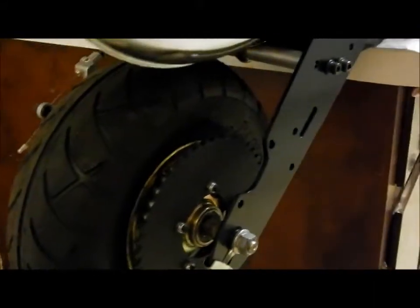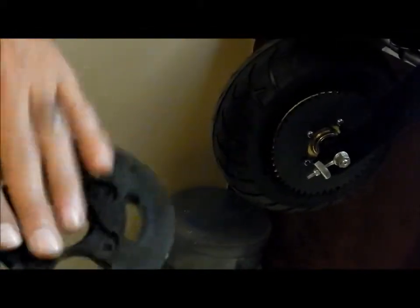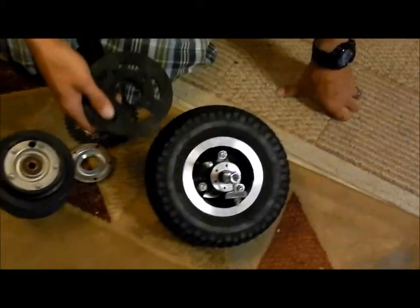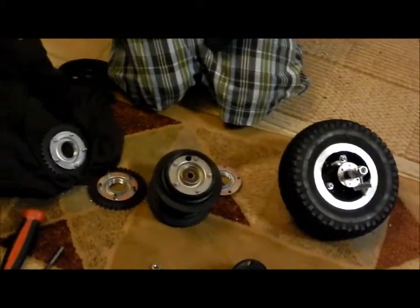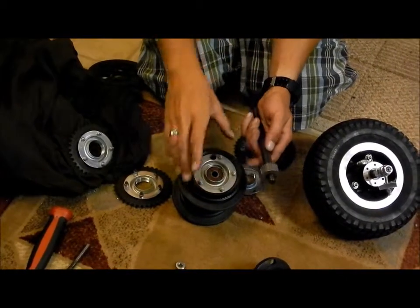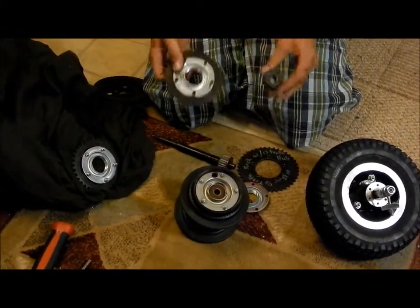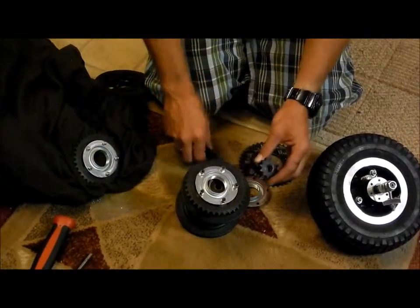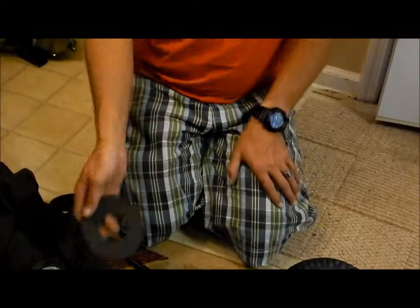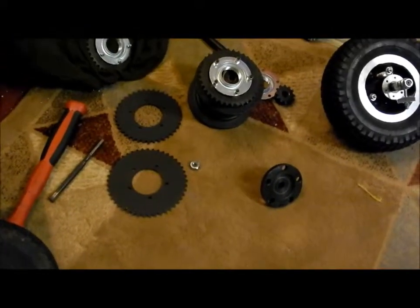The same hardware kit works for both models — including models with bigger tires that have a star-shaped sprocket recess. If you have one with a star-shaped sprocket recess, you may not be able to go with an aluminum wheel unless you decide to go chain drive. The Nuke Gas Scooter's factory gear ratio is 20 teeth to 60 teeth — that's a 1 to 3 ratio. For chain drive you would go 12 to 36, which is the same ratio. But if you want more torque, you could go with a 40-tooth or 45-tooth. We also have 48 and even 52 teeth, which are for models with bigger tires.